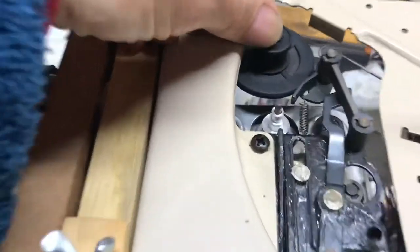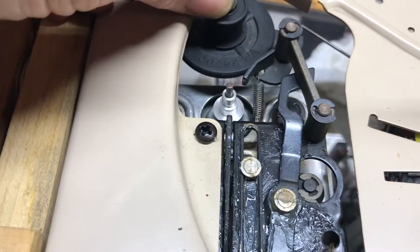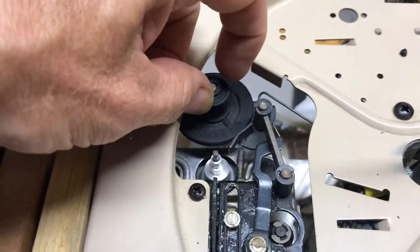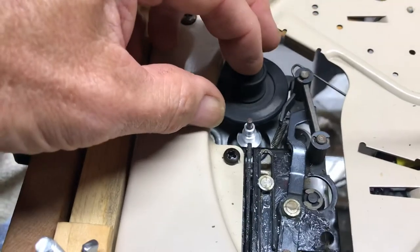Turn this on, move this over — the motor's spinning. Get your Q-tip with some alcohol and put it on all four steps of the motor. Let that dry out. Then get your Q-tip and put it on the rubber here and here. Just hold this over here and let it spin. Put your Q-tip there and clean it, then put your Q-tip here and clean it.